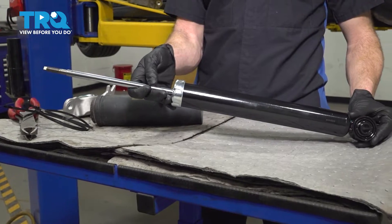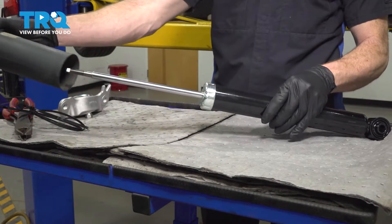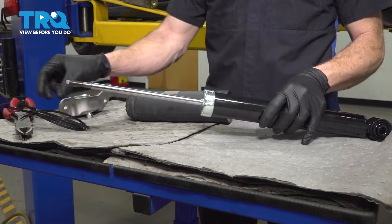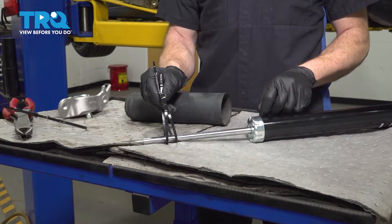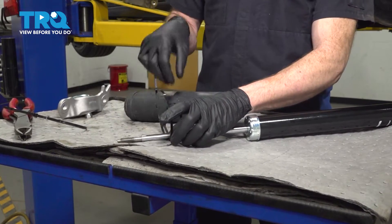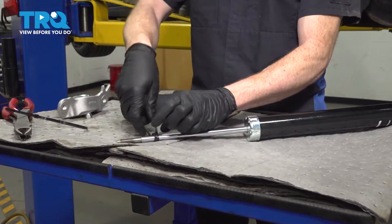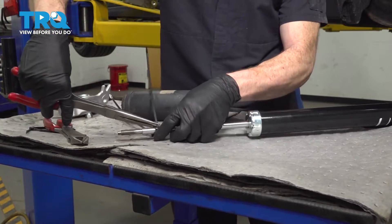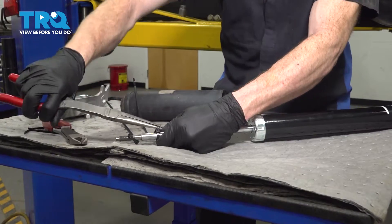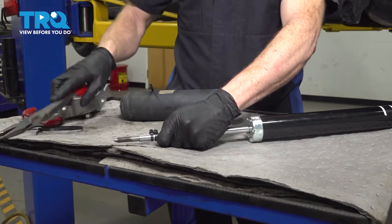Let's get ready to install our brand new rear shock — let's prepare it first. You will have this protective cover that you have to slide onto the shaft, but what you'll find is when you slide it on, it can just rattle around. To prevent that, use a couple of wire ties. We'll be using our two wire ties up along the top here, not down along the bottom, because we don't want to cause any restriction. Just make sure these are nice and tight — it's good to try to prevent these from sliding down the shaft. We do not want to cause any restriction in the shock.